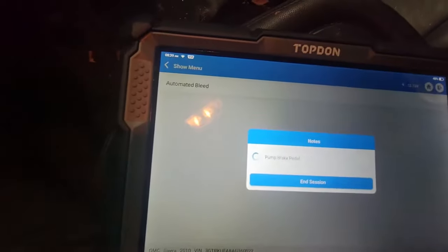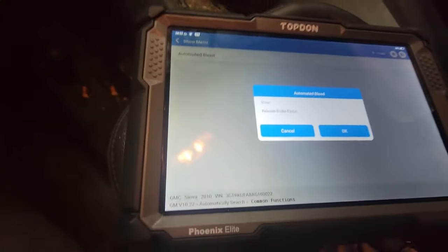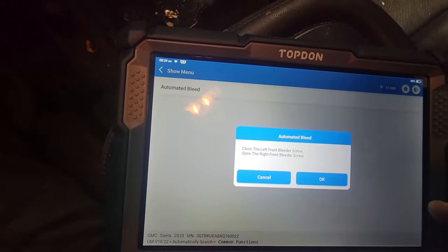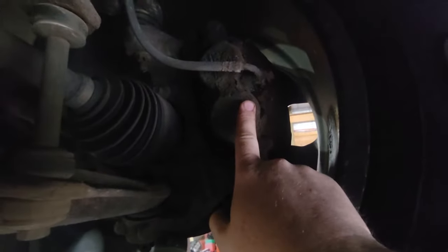I'm in the vehicle, pumping the brake pedal. There's no pressure there, so that's not a good sign. I come back down and I would expect everything over here to be covered in fluid, but there's absolutely nothing. I'm wondering if the passenger side had pressure, so I took that side completely off — no pressure at all. Still got 15 pounds in my power bleeder, and no pressure at all.